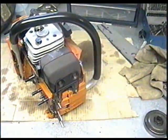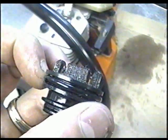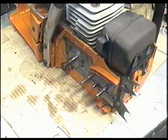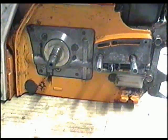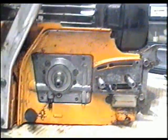The saw has been sitting for 24 hours after putting the other oil cap on and there's no oil leaking at all. So more than likely it was just the o-ring. You could replace the o-ring but you have to make sure it's the proper material — usually it's Viton rubber or nitrile. It kind of looks like I took the clutch and everything off for nothing, but now I'm sure there's no oil leaking out of any of these areas, which eliminates the doubt. As you can see, she's nice and dry.